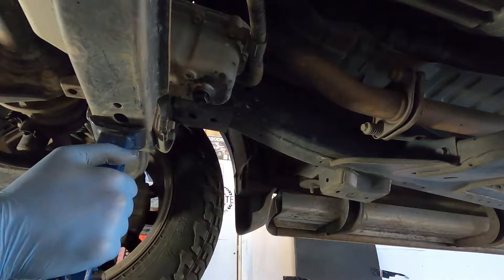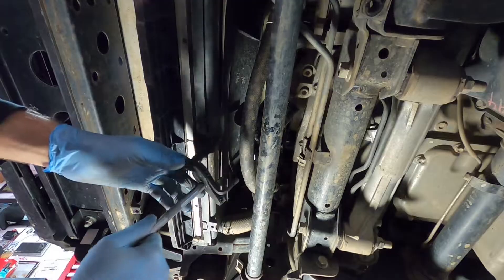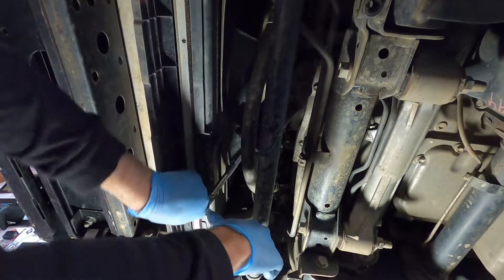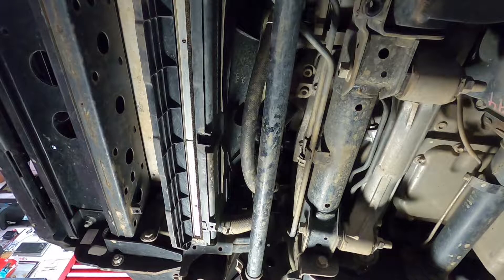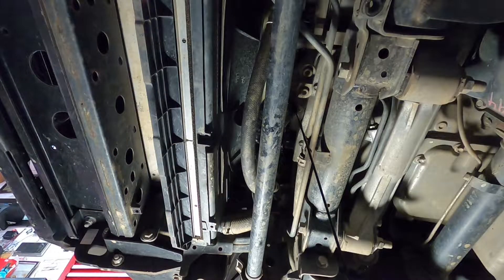Now we'll drop the oil filter - this is the point where you'll really need an oil filter tool. The claw-type tools are probably the best ones to get; strap ones from Supercheap are pretty good too. This one's not too bad - I thought it'd be super tight after the way they did the sump up. Once you get it reasonably loose it's going to start to drip. Just loosen it off and let it run - once it's sitting there, let it run until it stops. You don't want to pull it out too early because you'll make more of a mess.